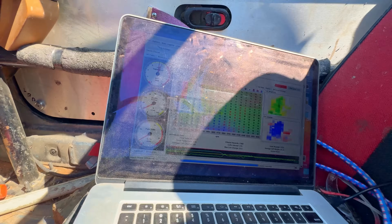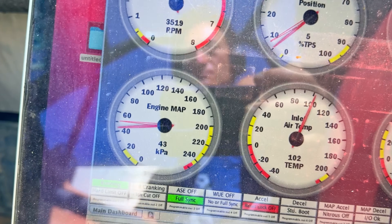The time has come to dyno the Baja Miata. I'm sticking with 20 extra HP. I wish we could beat the Amazon, but I unfortunately don't think it's going to happen. We did some tuning runs this morning and we were only about 3 PSI, so that 20 is probably about right. I don't think 20 is the limit — I think just 20 is where we're at. The intercooler did drop the intake temps 100 degrees — from 200 down to 100, which is insane. But the coolant was like 240 plus, even on the highway, so we've got some checking to do on that. Let's get her into the dyno.